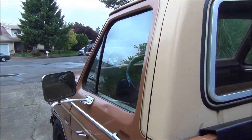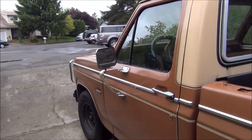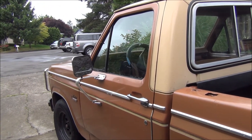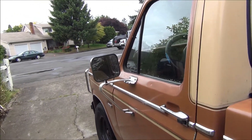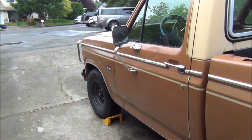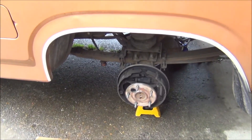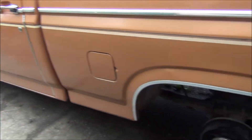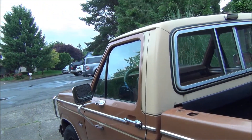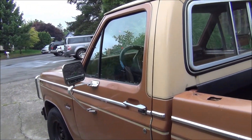I'd like it to be maybe 2,000 RPM. I believe the operating range of this engine is 1,500 RPM to about 4,000–5,000 RPM where its peak power is. Maybe an E4OD and a 3.25 rear end would bring the RPMs down pretty low, and I'd be able to do about 85 miles an hour doing the RPMs it does now, which would be cool.